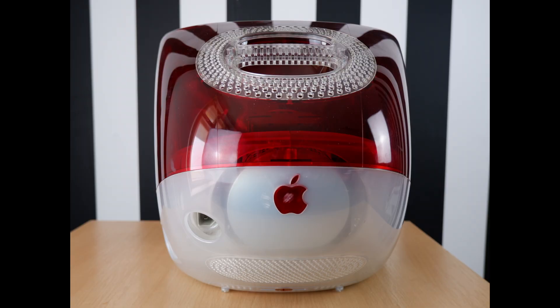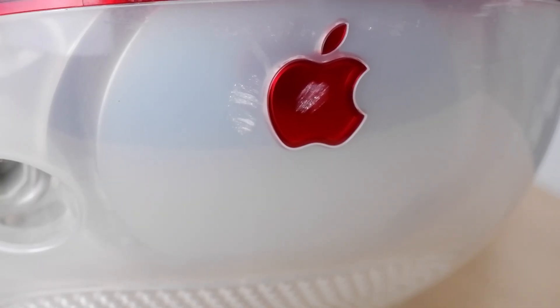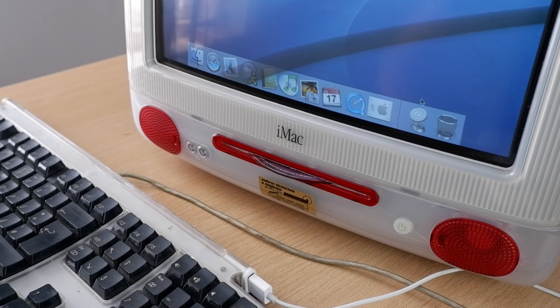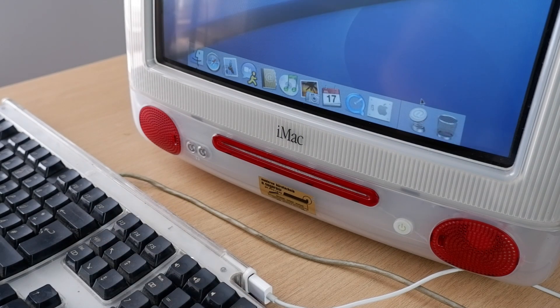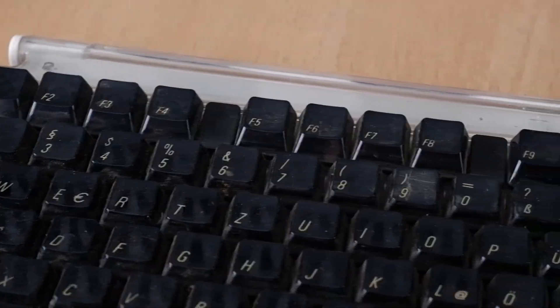Generally, Ruby is in pretty good condition with just a few light scratches along her case, which is not bad for a 22-year-old machine. Her only issue is with the DVD drive. The drive reads DVDs and CDs fine, but when it comes to ejecting the disc, she's a little clingy. Chances are the rubber belt has just worn out over the years, so I'll need to remove the drive from the case and change it out for a new one. While I'm in there, I'll also change the PRAM battery before it leaks and ruins the board. Finally, I'm going to take a look at the keyboard, which needs a little bit of a clean.